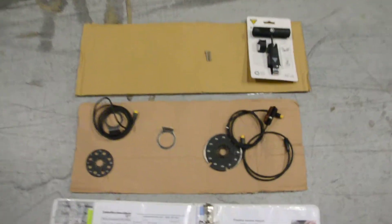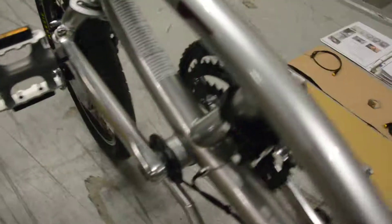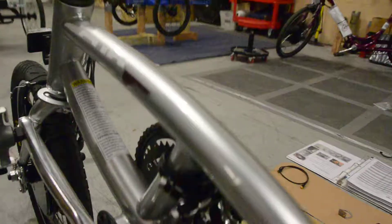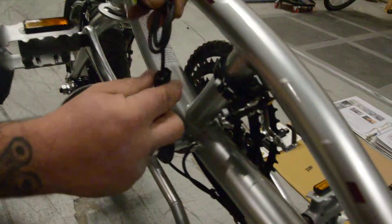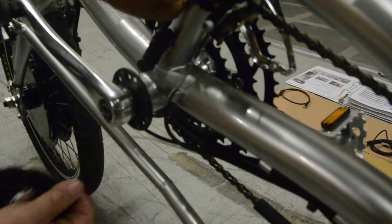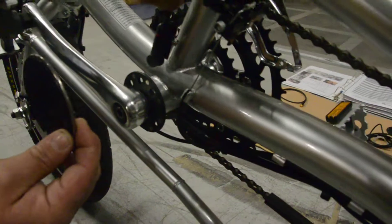When we mount the pedal assist, we have to mount it on the left-hand side when we're using our ring-type TDH sensor. We do a direct mounting where we drill and tap the frame to mount the sensor directly on the left side, because there's no room on the right side for a ring or a sensor. If you want to do it the simplest way, use our regular e-bike kit sensor — this just sticks onto the frame with its adhesive back, zip ties in place, and the split magnet pops on without having to remove the cranks or the bottom bracket. So it's easy to do at home.